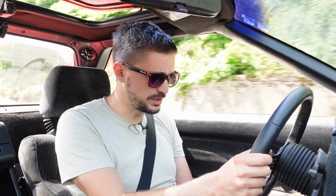Okay, the garage is very close by. I'm going to go back to the garage, and then I'm going to try to set up the blow off valve. Also, everything so far seems to be good. Oil temperature, okay, 84 Celsius. Water temperature, 80 Celsius. Air temperature, 44 Celsius. Everything seems to be really, really nice.